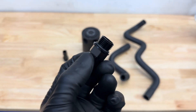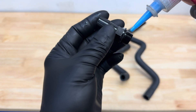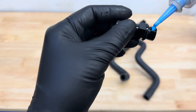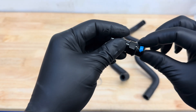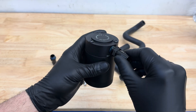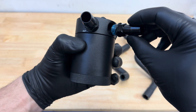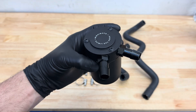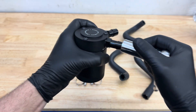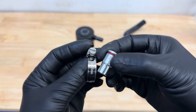Next thing, we're going to prep the in and out — the two valves. They are sealed and have o-rings. You don't technically need to do this, but I'm going to add some Loctite on both of them to make sure they don't vibrate loose and that it completely seals. This is completely optional, not necessary. When you thread them onto the catch can, they go on very smoothly without any resistance. If you have resistance, it means you're cross-threading — stop and make sure everything's fine. A deep socket 17 millimeter will get it on there. Not using a lot of force — that'll hold it in place just fine.